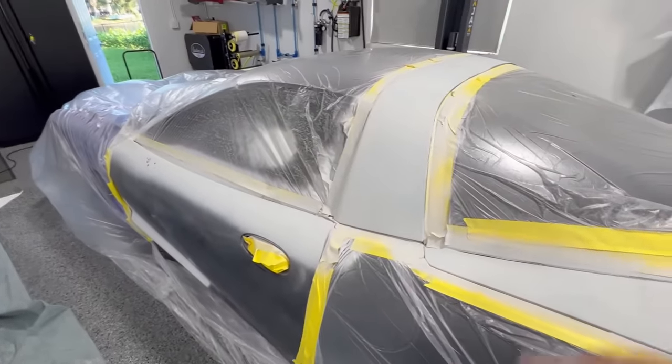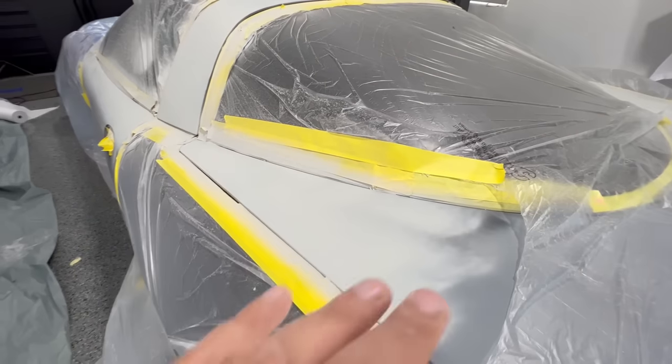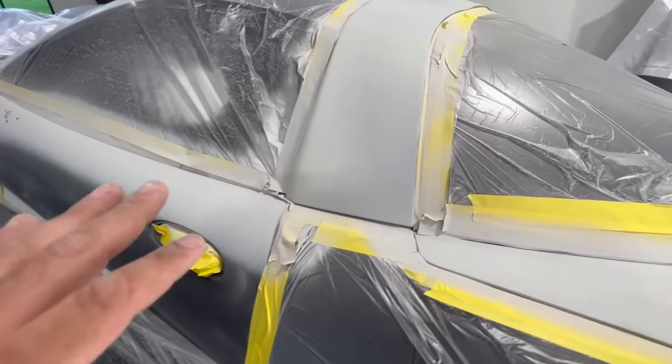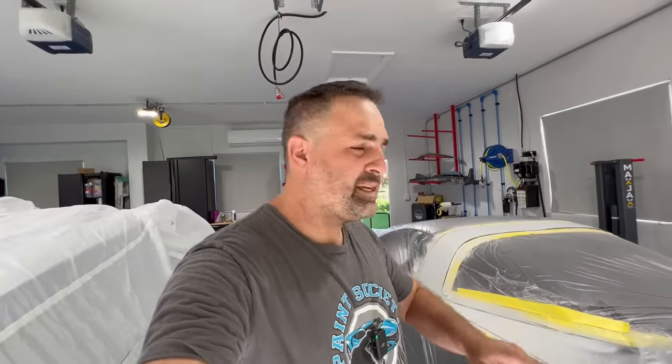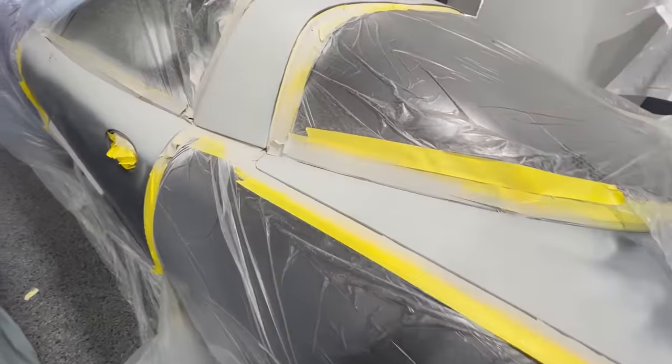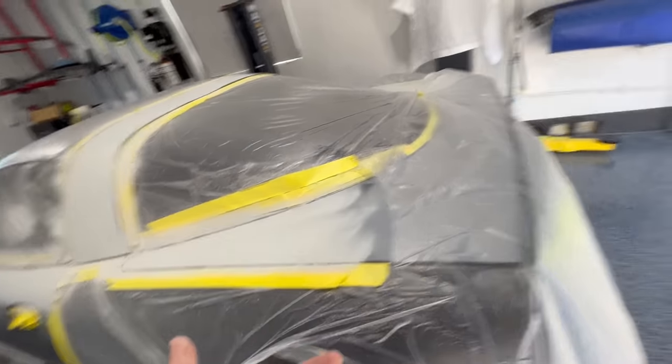After 30 minutes we applied two coats and it's looking great, ready to go. Now epoxy is not really meant to be sanded and isn't intended as your only primer for a full restoration, but here we used it just for burn-throughs and light scratches glazed with polyester filler. In a couple days we'll let it really dry, then lightly wet sand with 400 grit so it doesn't come up and will be perfectly smooth. I would never recommend epoxy-ing your whole car and going right into paint, but for spots it works fine.